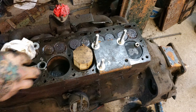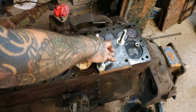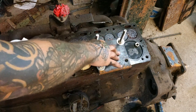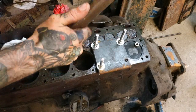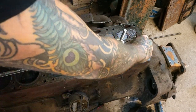If it doesn't work right away, if it doesn't let go, the other cool thing about this is the plate makes a perfect striking surface for a hammer. Your piston is already under pressure and there's a wood block on there, so it's not going to be as hard as metal-on-metal contact. And the pistons came up even more — these are all loose now.